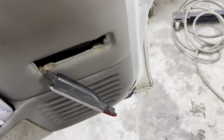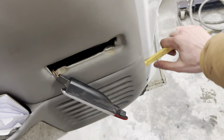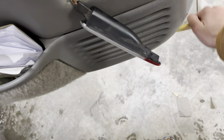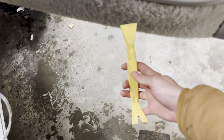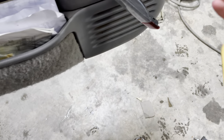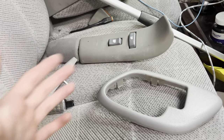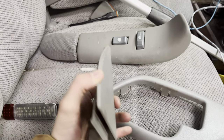After you do that, you're basically just going to want to pop all of this off right here. You'll see you shove it back there and there are clips all around this door panel. I would recommend getting another set of clips in case you break any, because remember you are taking them off an older truck. Even on newer vehicles I'd still recommend getting more door clips, as there's a possibility you can break some. Just grab a trim tool, or if you open it up wide enough you can get your hand in there and slowly pop out those clips.